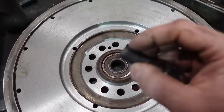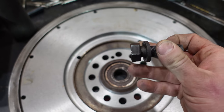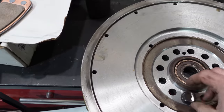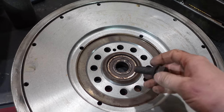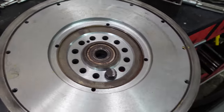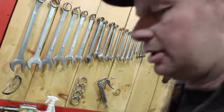I'll probably take about a quarter inch off of the end of the bolts. We'll stick those in the lathe, and we'll just shave the same amount off each bolt. We want to keep those bolts balanced, so you can't take more off of one than the other. That way they don't bottom out in the hole and my whole flywheel will come off. So I would bolt that on and feel really good about it, but it's kind of a snowstorm outside. That's not bad, it's settled down a little bit, but we got a ton of snow,